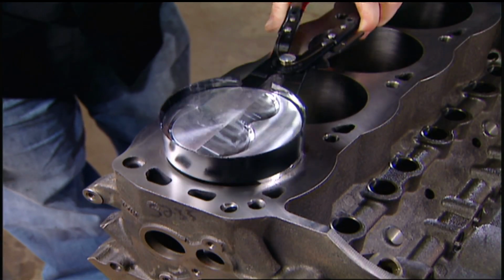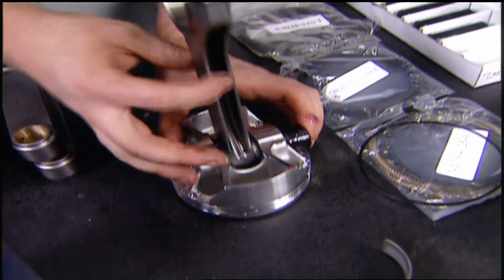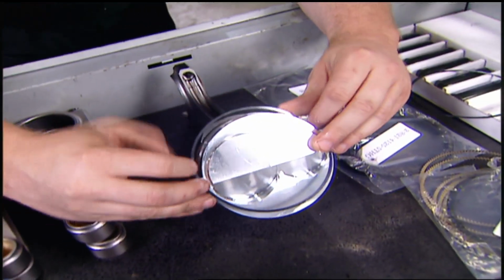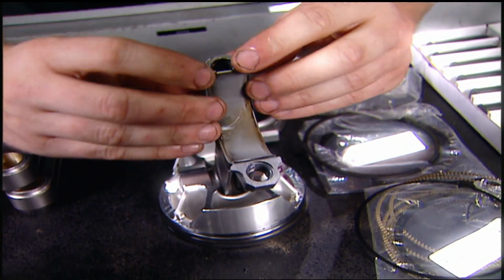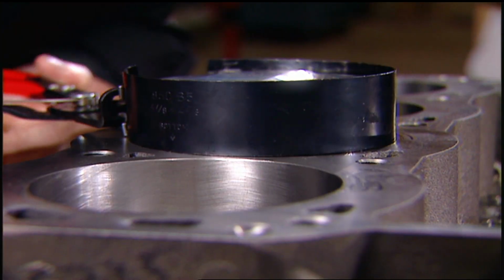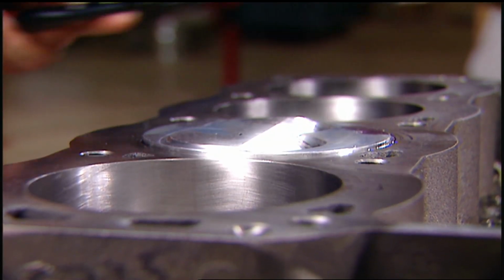The lightweight pistons allow the engine to reach higher RPMs without the fear of damage. When this engine is spinning at, say, 6,000 RPM, the piston is traveling from the top of the cylinder to the bottom, stopping, and then returning to top dead center 100 times per second. The stronger rods and crankshaft help hold the assembly together. This strength is needed to provide reliability during a race.